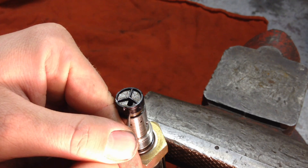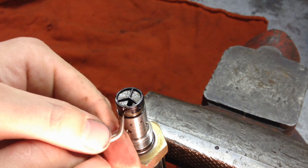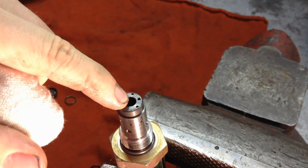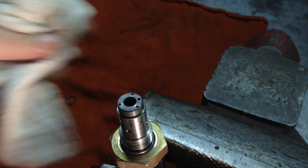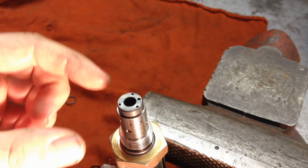We're going to pull the screen off here — it's kind of hard to get them off and I've never been able to get one off without destroying it. Once you get one side up it'll come out. I'm going to show you the piece of debris down in this hole, because that's where the debris went through and it's holding the actual pintle seat valve away from its seat. So it's constantly dumping IPR oil and won't build pressure, especially from a cold start — this actually caused the truck to die going down the road.